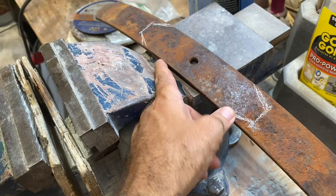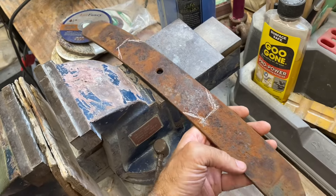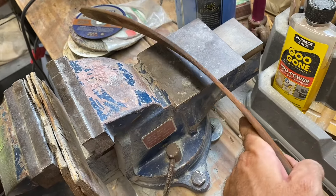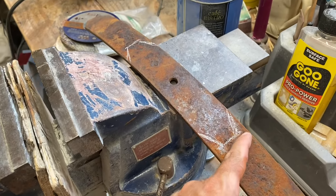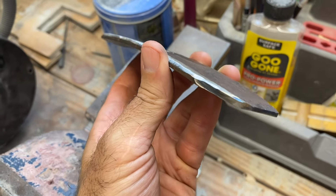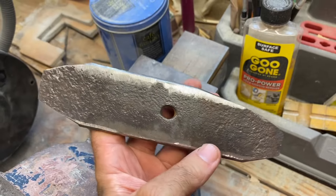I was missing my top leaf, and after further discussion on our MAFCA group it was determined I needed the proper thickness. I got a number three leaf from Steve Becker out in Colorado, because my number one leaf is the first to get broken and the first to get lost. I'm going to grind it down and replace my first one with an original leaf spring, putting a little bevel on each side.